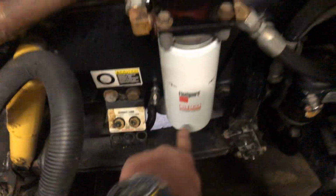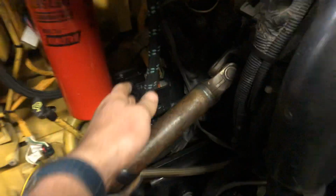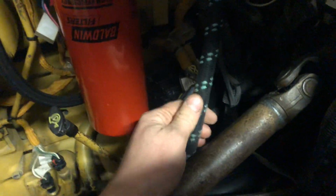Monday today. I'm gonna go to work up here after a bit, and people who've seen my previous video will know what I'm talking about. I made the line going in, pressurizing, feeds the water separator, goes to the transfer pump, secondary filter, feeds the head, and returns it. So this is our return line. The reason I'm pointing at this, you'll understand in a second.